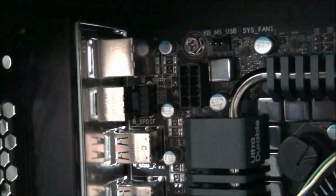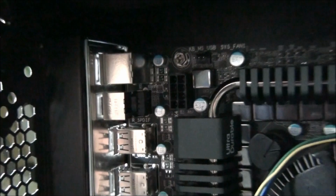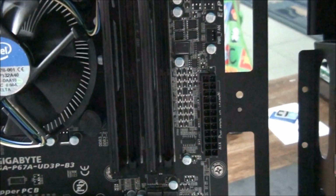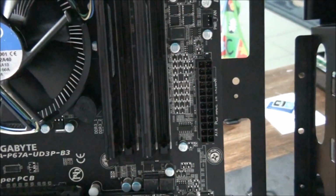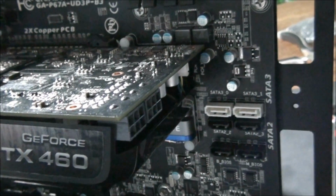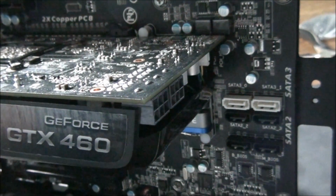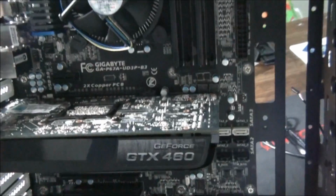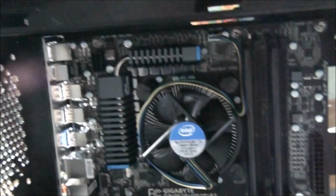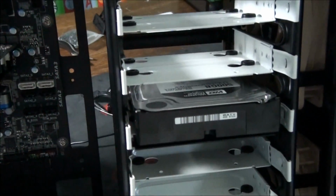So there's a plug up there. We need to run a cable up there. That's the 8-pin EPS or 12 volt ATX CPU power. We've got another one here, which is the 24-pin motherboard power. We've got another one there, or two, which is 6-pin PCI Express. Depending on your graphics card, it might be 6-pin or 8-pin. So look at the cables, figure out which one you need to go where, and that's how you start the thought pattern of, like, for your cable management.